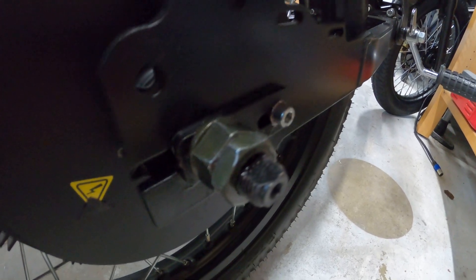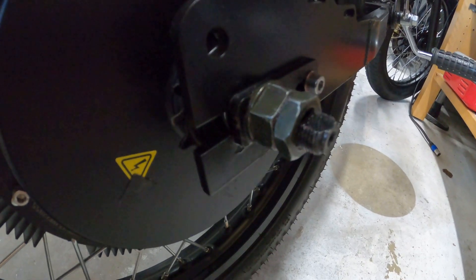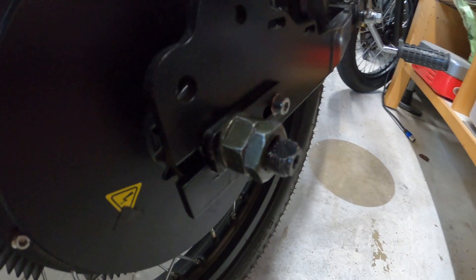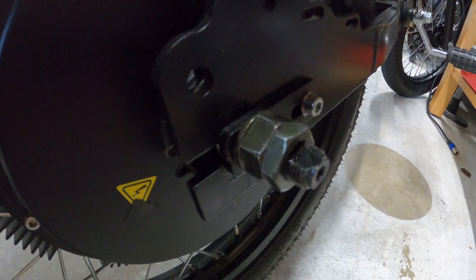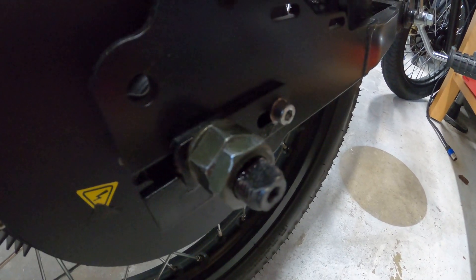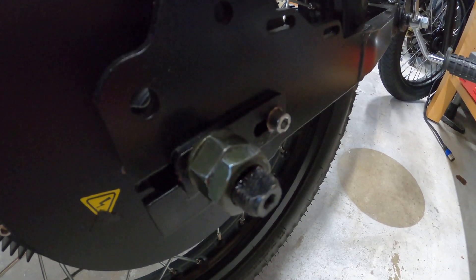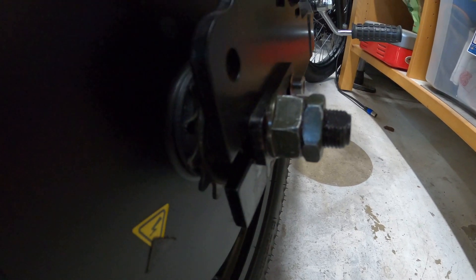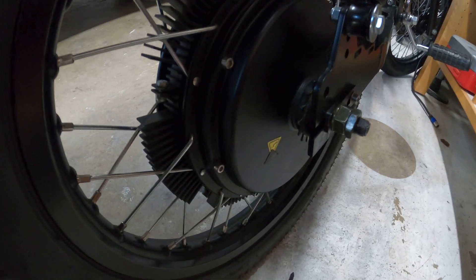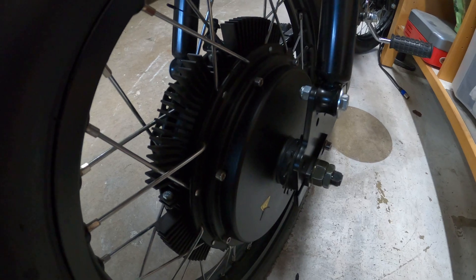Be very careful with your motor stays — these things have cracked on me. That's the torque plate that connects between the axle. I had to upgrade these — Ryan Dean on the Onyx mods group makes them, and they are a worthwhile upgrade. They are made out of hardened steel and won't crack on you. I also used red Loctite 262 on this because the bolts were loosening with regular blue Loctite. Red Loctite has solved that — now it's all nice and sturdy, no more cracks.